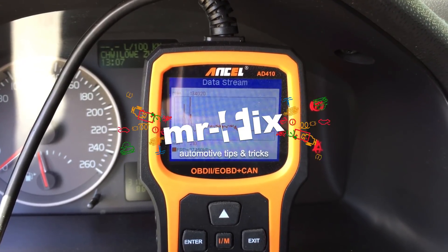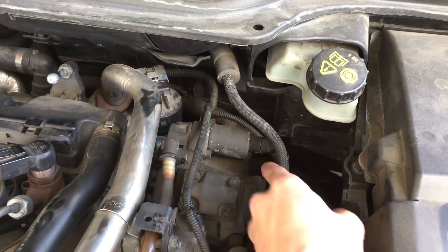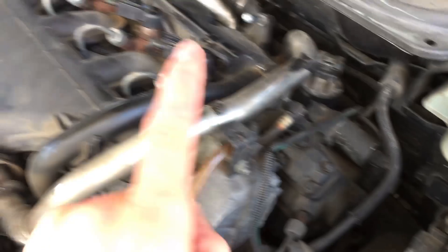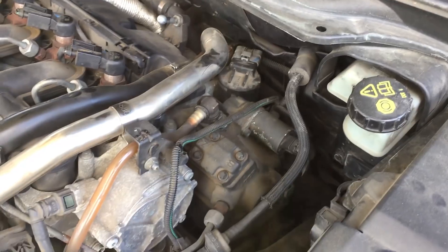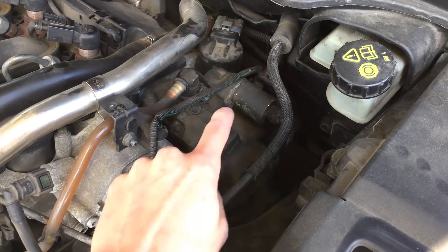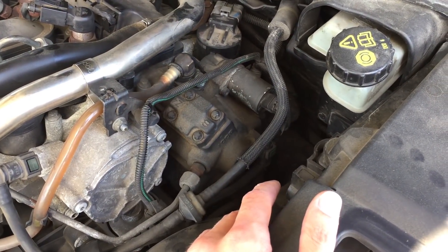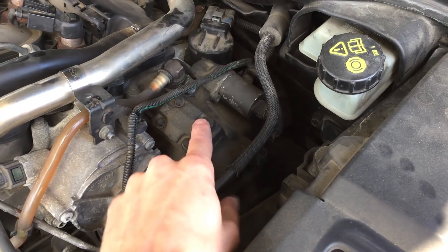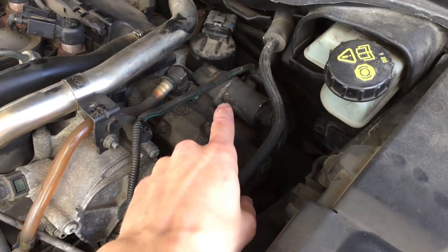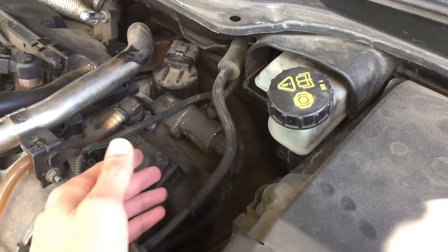I think I know what's going on with it. Most likely it's this valve - this is the fuel valve. It regulates how much fuel is going to the fuel rail, so it regulates the fuel pressure. Below is the fuel pump which is aluminum, and I guess when it's old enough, when your car has a certain mileage, there are aluminum pieces going from the pump to the valve into your whole fuel system. If an aluminum piece is stuck inside the valve it can cause such problems. So maybe let's try to remove it and clean it.